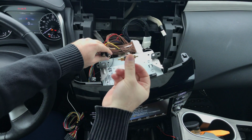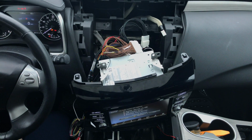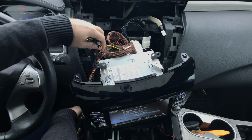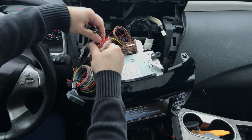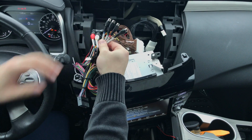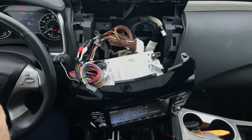You need something like this. Plug one, and you plug in the second one. This is how the audio is going to travel from the interface into the system, and then you take the two audio RCAs and you connect them together. These are your extra cameras. You can install up to 4 cameras. So you have the rear camera, you can install side and front cameras.